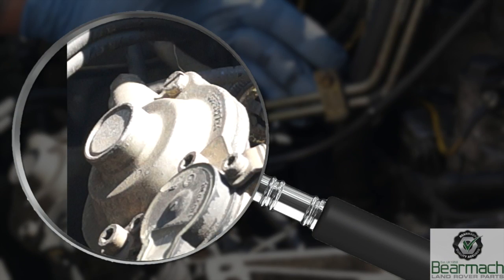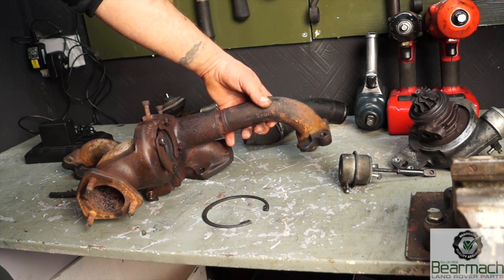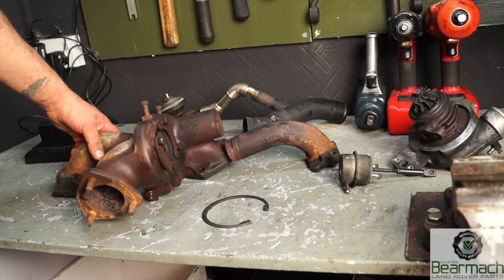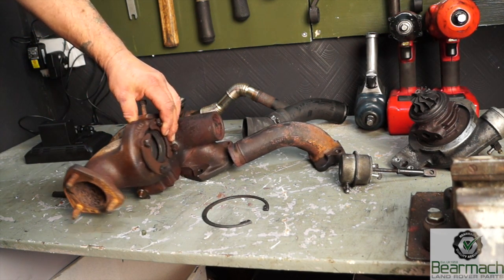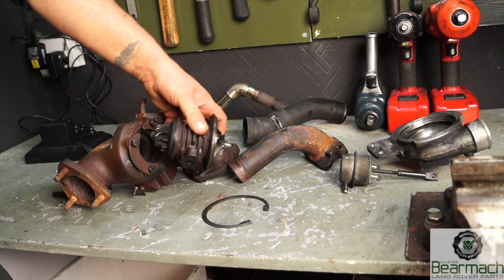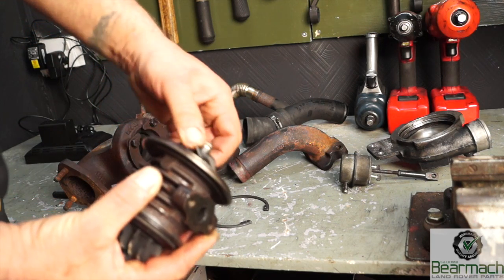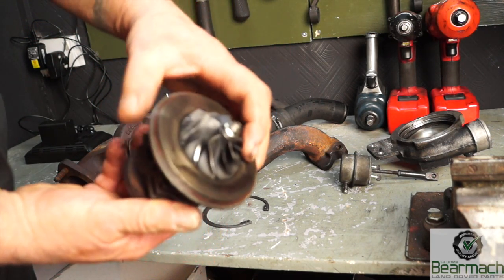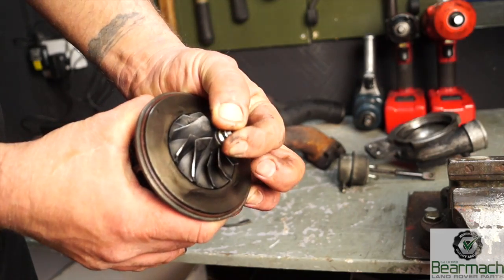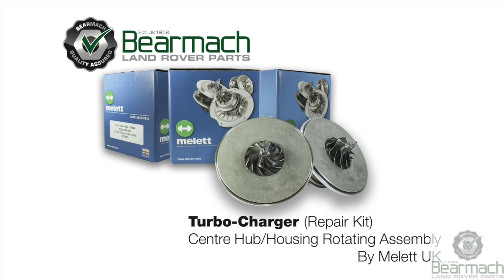This union goes off to the injector pump boost module, which is on top of the injector pump. Stripping down the turbo: on the 300 TDI, the branch manifolds have two branches which knock off — they are just a push-fit and knock out with a soft hammer. The turbine side, which has bearings, is clamped in and the other side is held in by a circlip. This is the part that will go wrong — seals will leak and fins will get damaged if there's any debris.